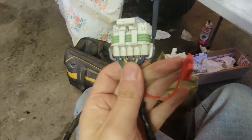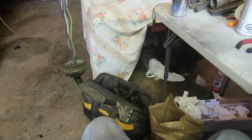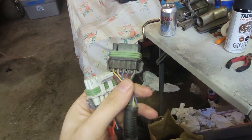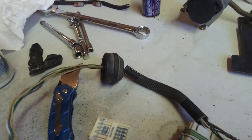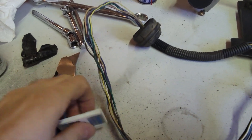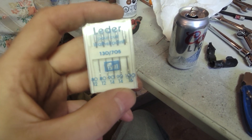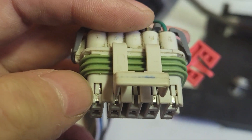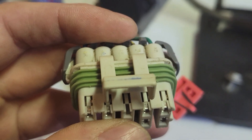Alright guys, I started getting the wiring stuff separated and peeled, and I got pictures of where every wire goes on both plugs, because we're going to be deleting some wires. I couldn't find a pin removal tool, so my grandma — god bless her soul — had some needles in her sewing bin. I tried one and it worked: it lifts up those little tabs and then I can just pull the plug out. Thank you grandma.